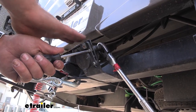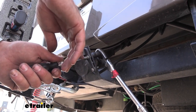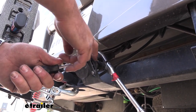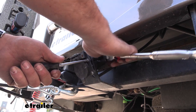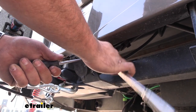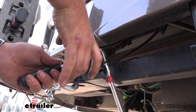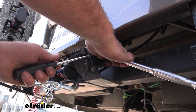The first step is removing our old 7-way plug, and it's going to be different from vehicle to vehicle. Ours just has a Phillips-head screwdriver with a 9-millimeter nut on the back. There should be four of them generally mounting up, and removing these is going to allow us to get to those wires and work on this a little bit easier to get our new plug on.